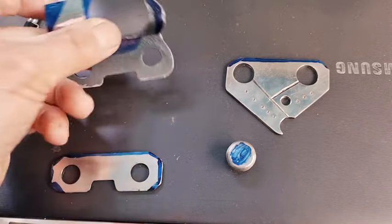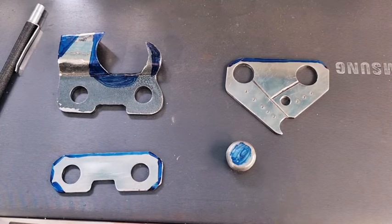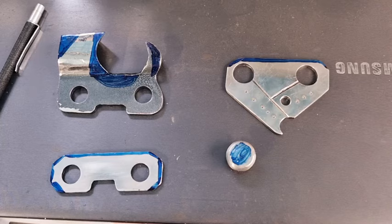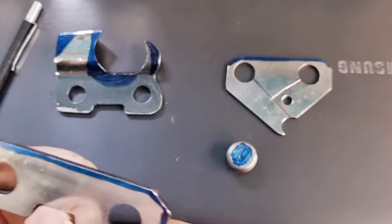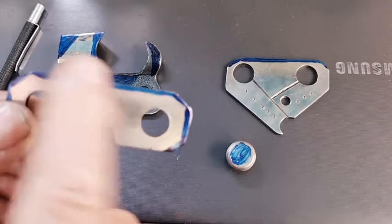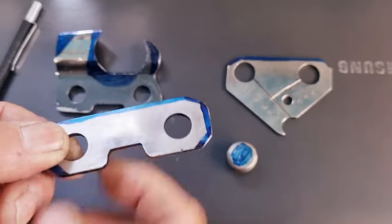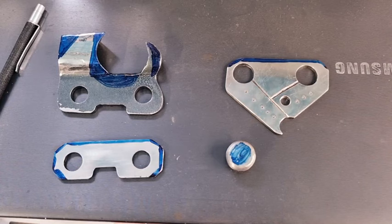Normally the top plate angle on most of them is going to be around the 30-degree mark. Some may even want to go a little bit more than 30 degrees — it's all customized. At home they'll play around with their race chain, do a few experiments, and go with that. You'll find most chains look very similar. After they file, they run the file over the top and around the edges using a very thin file, put a 45-degree bevel on the side, and some have even put a 45-degree bevel on the bottom just to get rid of more weight.